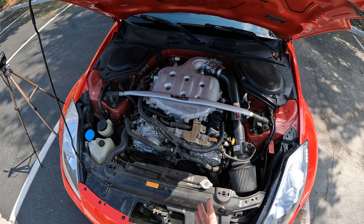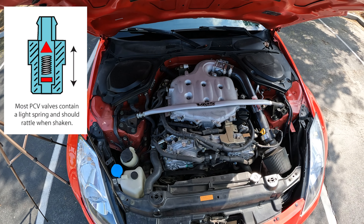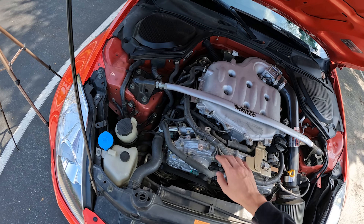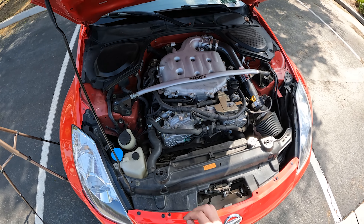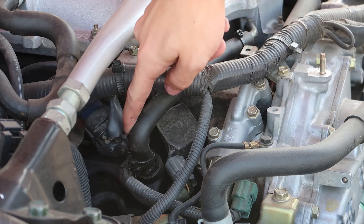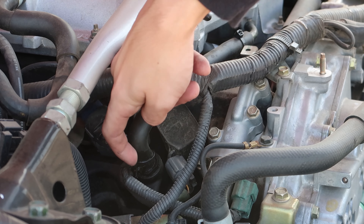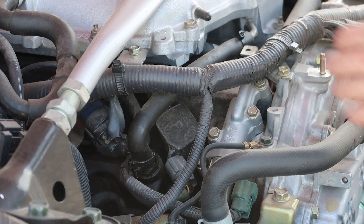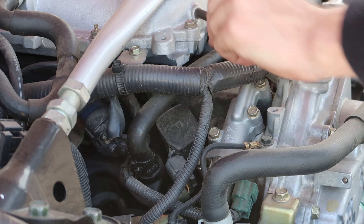So that's why we're here today — we're going to check it out, see if the ball valve still sounds good and is releasing built-up pressure back into the motor. The PCV valve is right here. Mine is held on by zip ties and runs into the intake. These zip ties aren't really held on by anything, so we can just pull this off right now.